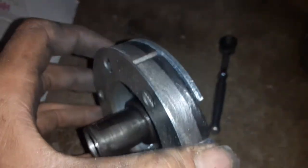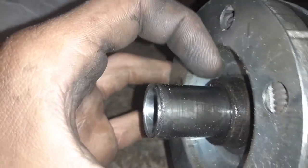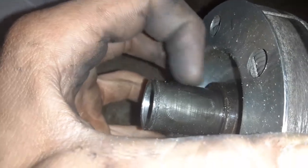That's what the shoes look like after a quick sand. I'm gonna take some paper towel and wipe down the shoes and wipe down this surface right here, then sand the drum on the inside and wipe down this bronze bushing in there.